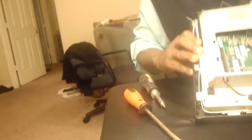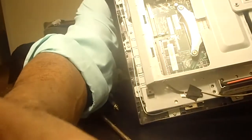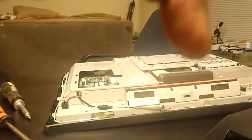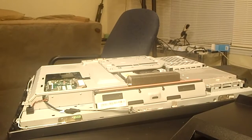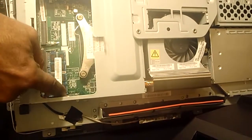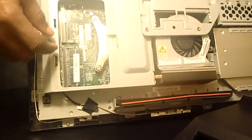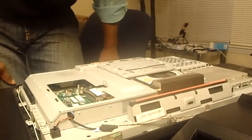In an all-in-one, the RAM location is different as well as the length. A regular laptop will have RAM that's twice the length of this one. And in a regular desktop, the length of the RAM would also be twice as long. This is the only one here — it has a shorter random access memory stick.